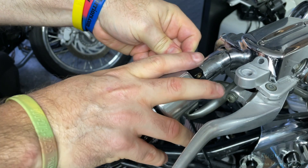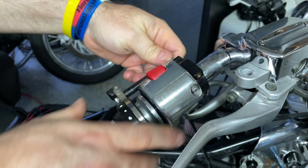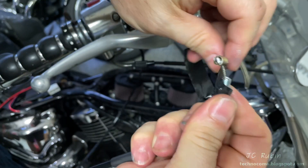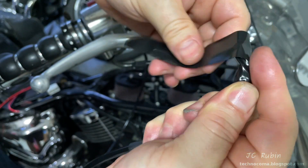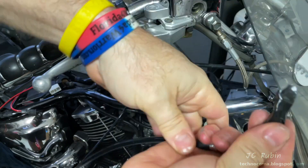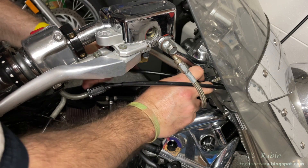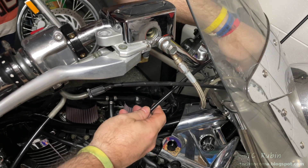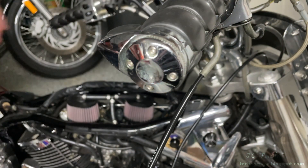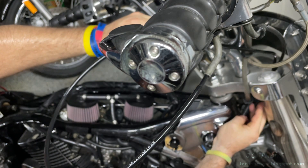I reconnect the linkage for my cruise control and install the screw for the cruise control. One more quick test to bring this cable into the all-the-way-in position, then I put some tape over it to protect the cable and make sure it doesn't bind for the next step. Since I only removed one cable, I know which way to run it — parallel with the existing cable. Take care through the entire procedure that there are no sharp bends; that will immediately cause irreparable damage to the cable.